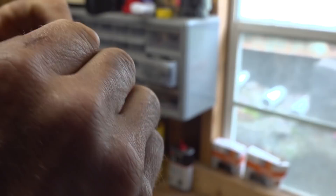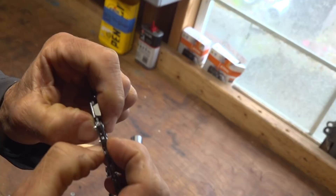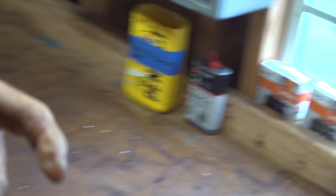I just pinch it and capture that. A lot of times when you put it in here — yeah, trying to get the right angle — you can see how the rivet punches in and then that little receiver piece goes on the other end. Now you've got two bits of metal sticking out that we've got to flatten so that becomes a permanent link.